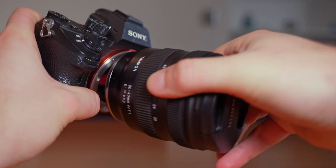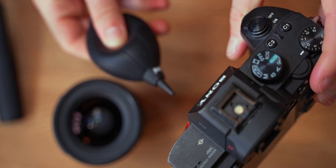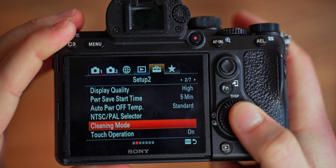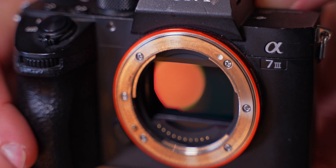Take your lens off, keeping your sensor and rear element face down. First, I like to dislodge as much dust from the internals as possible using an air blower. Your camera may also have a cleaning function — hold its sensor down and open, then start the cleaning process. It will shake the sensor aggressively and hopefully eject most of the particles. These steps are often a good fix if you don't have swabs or time to clean.